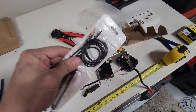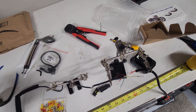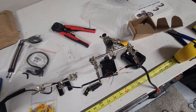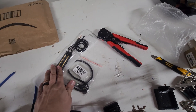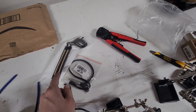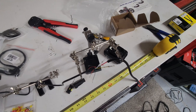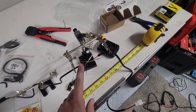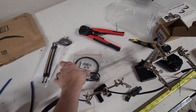I typically will actually solder on the blinkers, because there's no sense in having a connector when, if you do it correctly in the right order, you just don't need one. It saves time and money, and also saves you the headache of any connector issues. Basically what I suggest is: whenever you wire these up, turn on the kit off the bike. Make sure everything is in the right place, because you can put these on backwards. So before you zip tie them down, take off the adhesive backing and make sure they're on the correct side of the bike. I will also be putting a 5-pin connector for the taillight inside of all of this, and I'll obviously be wiring in the banjo bolt sensor.